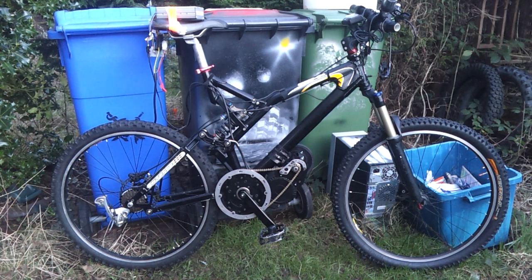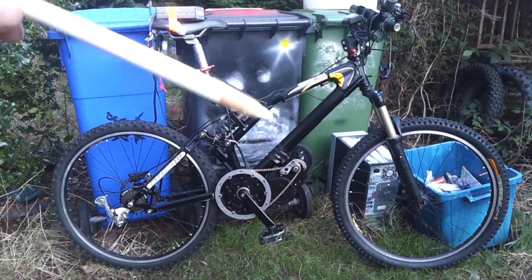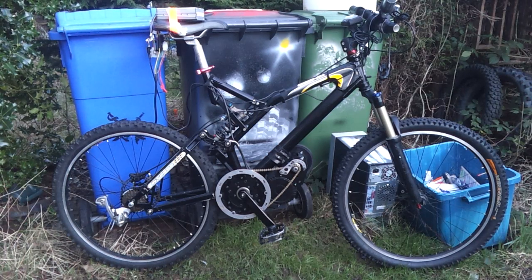Just traditional brakes front and rear, just like on a mountain bike. Twist grip throttle, just as on the other one, and a Cycle Analyst strapped up there. The batteries would normally fill this compartment. They're slightly lighter in weight overall — those hub motors are a heavy thing. There is no regen braking on these setups because there's no direct drive to the motor, but you do get the benefit of having the gears, which means you can make full use of the power. You can take a little bit of strain out of the motor by having it in first gear, or sliding down through the gears for speed.